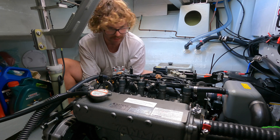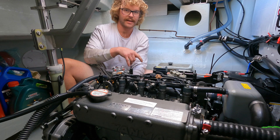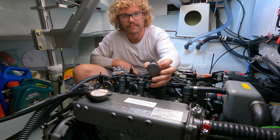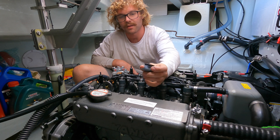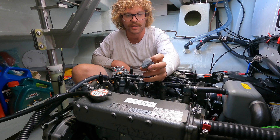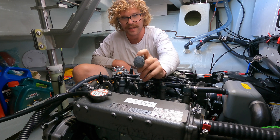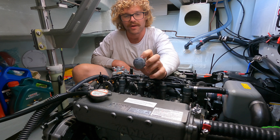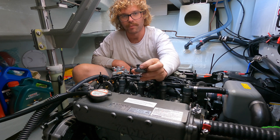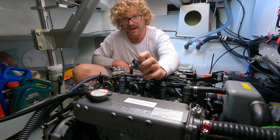Number one is starting to move. You'll take this bung out — this rubber plug — so you can see. Don't lose it. If it's damaged, get a new one. When you put it back in, get some silicone grease or marine grease and put a very light film on it, just to stop it degrading and breaking.